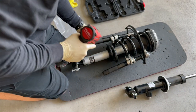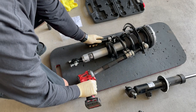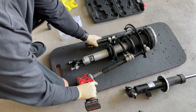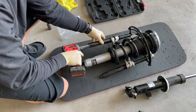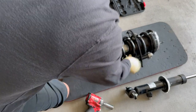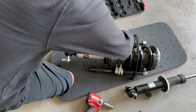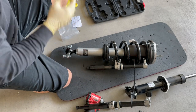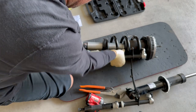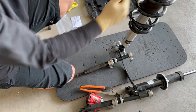Let's get the 18mm or 19mm back and decompress the strut — not that bad with this tool. Look at that, we've got our new strut assembly with the shock. These may need some channel locks to snug up. There we go, it's snugged up. There is our new strut. Let's get it back in the truck.